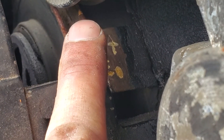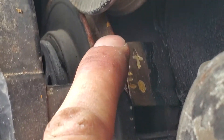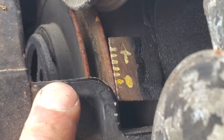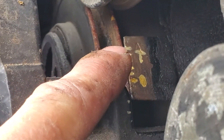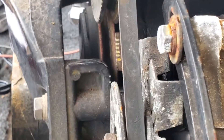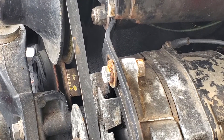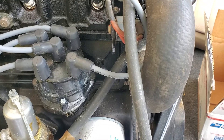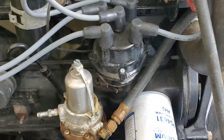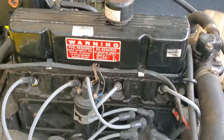The reason I mentioned there being two top dead centers is that the little yellow mark is going to be at the same position twice in the engine cycle — once while it's blowing exhaust gases out, and the other while it's compressing the fuel and air. I'm back on the other side of the motor now. Bear in mind I'm doing this example on a MerCruiser 140, a 3.0.